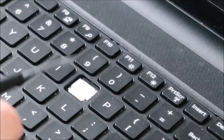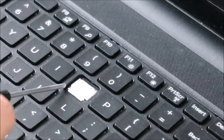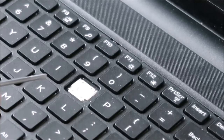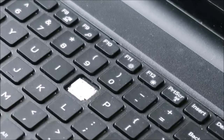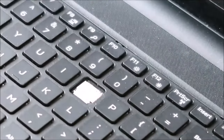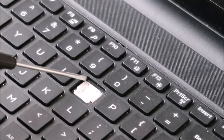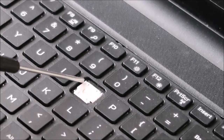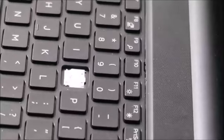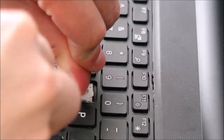In order to take this off, they're generally laid out in the same way. You have two metal pins toward the bottom corners and two metal pins toward the top corners. We're going to look for the metal pins closest to the edge, which in this case is the top. I'm going to take my fingernail, push up as much as I can to get some wiggle room, and then with my flathead slowly and gently try to pry the plastic part out from under the metal.